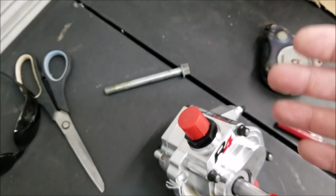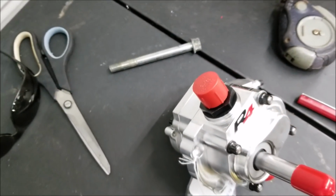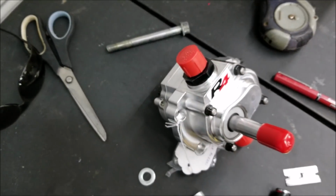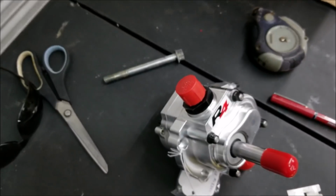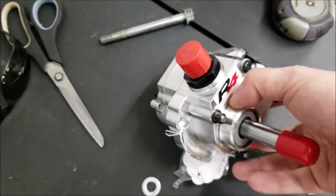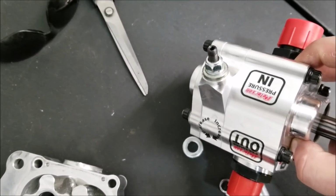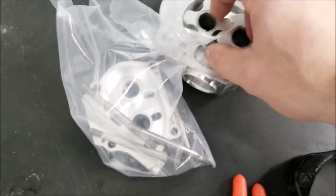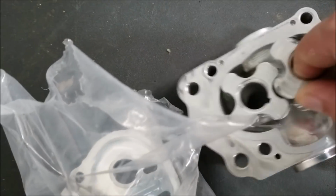So in other words, it was using the internal bypass on the engine with this thing maxed out 100%, and you're still barely hitting the 125 requirement, which is fine. You're hitting the 125, not an issue. You have perfect oil pressure, logs look good, everything looks good. But you know you're working the pump really hard if the pump's external bypass itself is not even open at all. And so when you take the pump apart, everything looks good. Then you pull the rotors out.